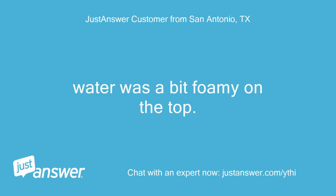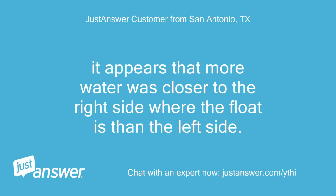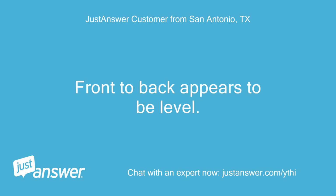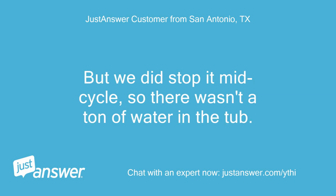Water was a bit foamy on the top. No soap was used in the cycle. It appears that more water was closer to the right side where the float is than the left side. Front to back appears to be level. We are draining it now to see if there is any water still in the tub. But we did stop at mid-cycle, so there wasn't a ton of water in the tub.